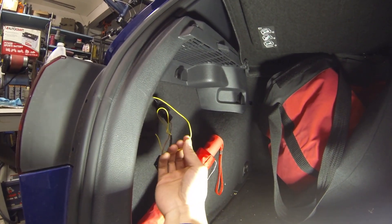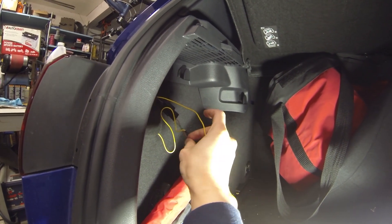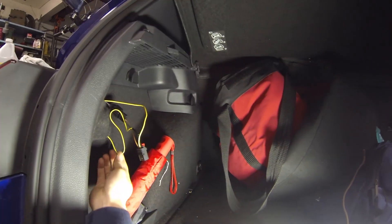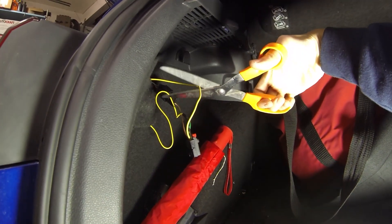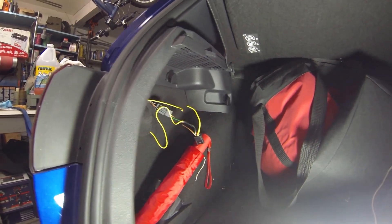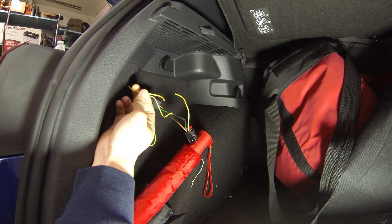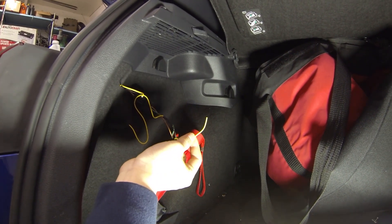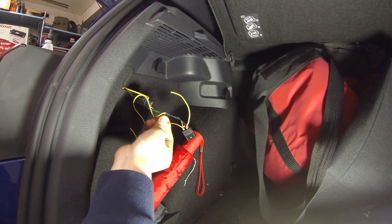This yellow one is going to ride all the way up to the inner tail light. The inner tail light is what will give the turn signal power, so this will be positive. The brown one is going to be our negative. All we have to do is splice into this. We'll snip this yellow one — the one coming from the inner tail light going to the outer harness. We'll also snip the brown wire, which is going to be our ground. I'm going to connect this to VCC and then also run a wire from VCC to the common. This goes to CK, and both brown ones go to the ground on the input side of the relay.